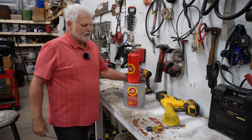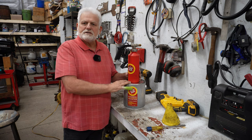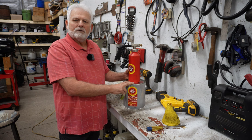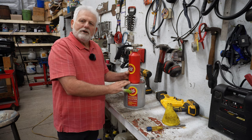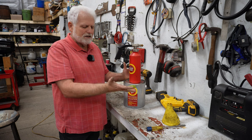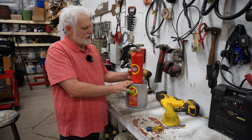The final step — I came across this product over a year ago and used it on my 1985 F-150. I put out a couple of videos about rust proofing that frame earlier this year after last winter. I was forced to drive that '85 last winter because that's all I had, so I went ahead and lifted it up and saturated it with this product. The issue with it is it's real sticky, and if you have to work on the underneath side of your vehicle, it's not pleasant — it gets all over you. This is Fluid Film. I'm not promoting it in any way, there's no paid promotion — I just came across it and liked it.